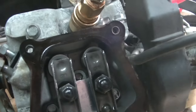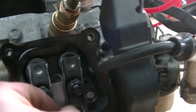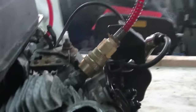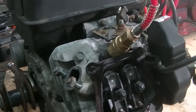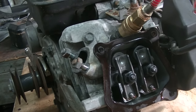What I've done here for demonstration purposes is release my vise grips and roll the crankshaft forward just a little bit so we're sitting on the compression relief — deliberately, just to give you an idea of the sort of thing you could expect if there was a more substantial leak. You can see the exhaust rocker is under tension while the intake rocker is loose, confirming we're sitting on the compression relief. I'm going to turn the air back on and you're going to hear a very obvious leak from the exhaust — and it is quite loud. That's what you'd expect to see if a valve was not sealing worth a damn; in this case it's held open just a tiny bit by the compression relief mechanism on the camshaft.